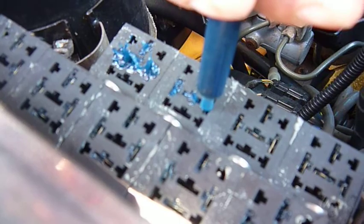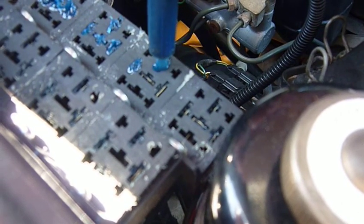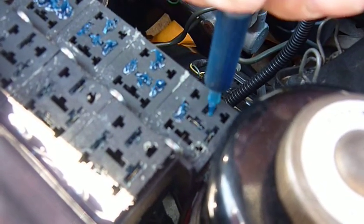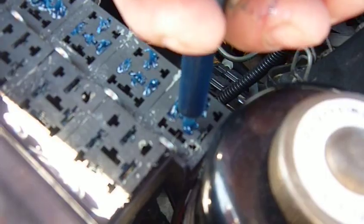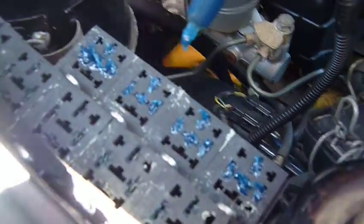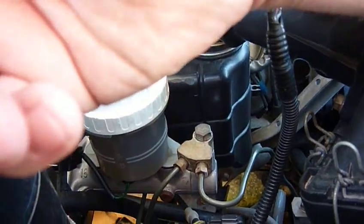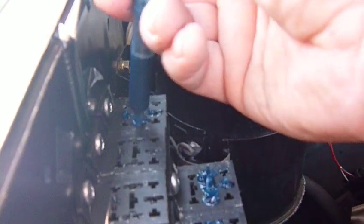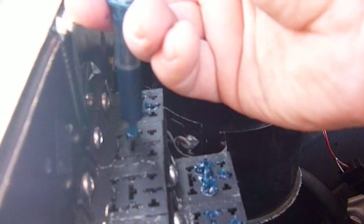You can see I've cleaned up all these — some are used as a crossover relay, some as a regular relay. These holders make life a lot easier; just put the connectors in where you need them. If you ever have a problem with a relay, you just pull the relay out and your connector stays in place. And worst case scenario, because you've got a holder, it's very easy to make a loop wire and bridge it if you don't have a spare relay to get you out of trouble.